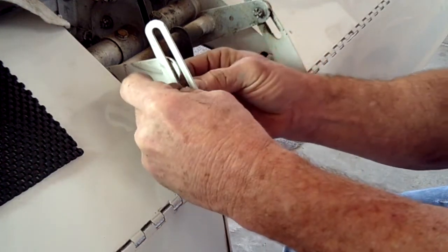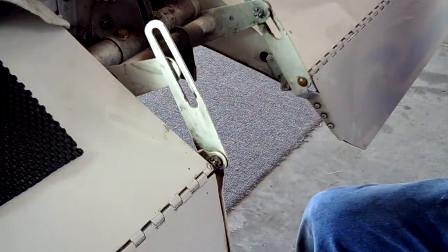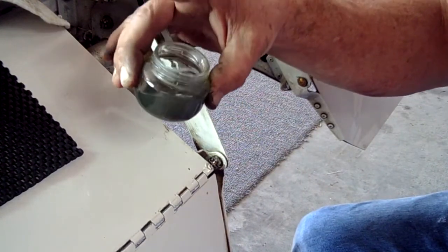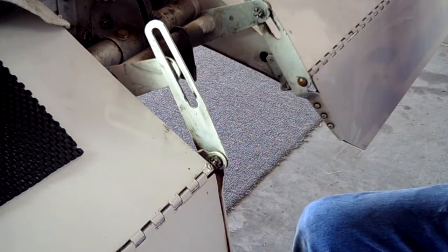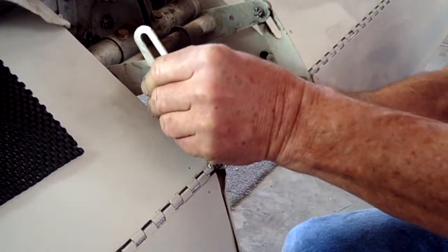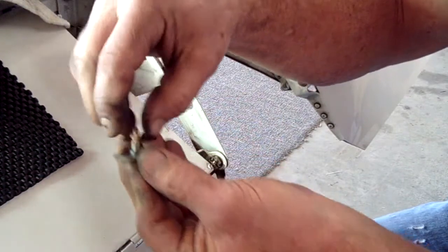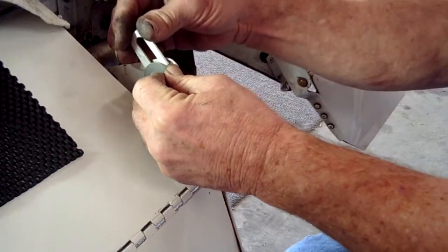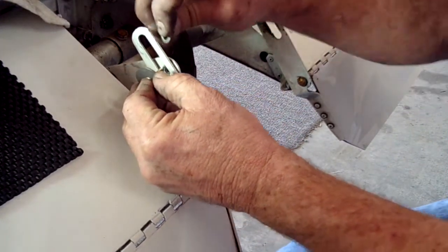They were pretty dirty. This was two ounces of 100 low lead aviation fuel — it was perfectly clear when I put those two small bearings in and cleaned them, so they've obviously been over-lubricated. The clevis bolt was in pretty bad shape, so again we're just going to go ahead and reassemble now with all new hardware. We're using an AN970-4 washer, and we want to make sure we keep our stacks right. Making sure everything cinches into its place, and then we have to get the spacing washer on the inside.